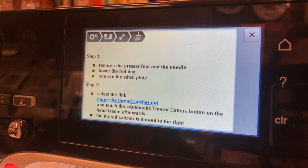Occasionally the metal part on the needle threader will bang against something and break off, or the needle threader won't work at all. With it most of the way down, bring your fingernail and pull down on the top of that light gray area — it'll snap right off. These are about $40 to $50 depending on your dealer, and you can put them on yourself. To put it back on, bring the threader halfway down, line it up, and there's a black roll pin that goes into that slot. Make sure it snaps all the way into the keyhole or you may break the little needle hook.